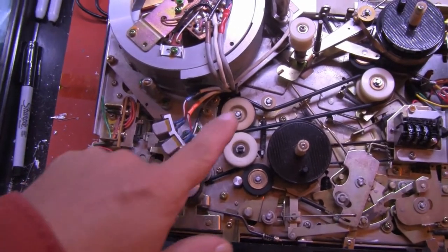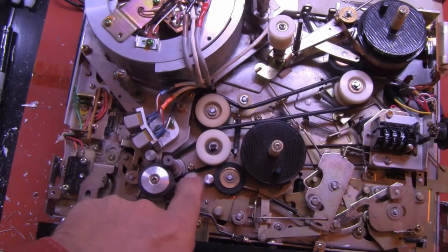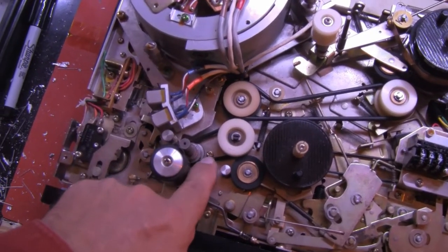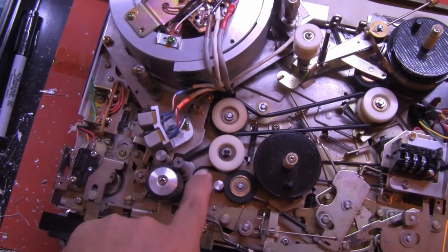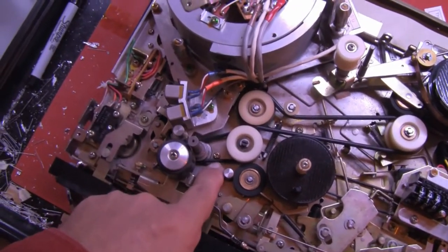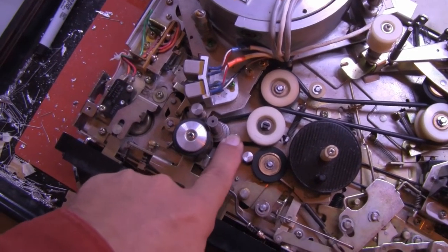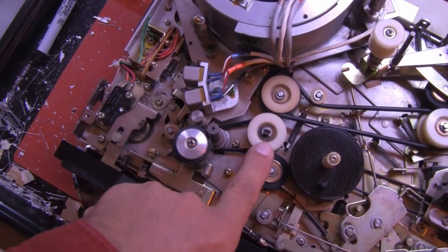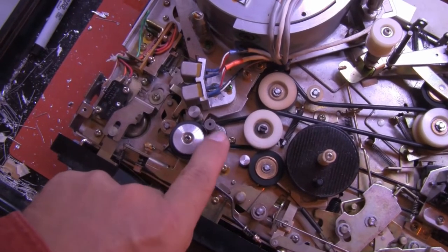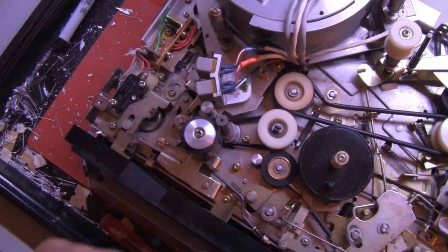So I will be replacing the small square belt. I don't remember its length — it's in the 4-inch range, not very long. I will be replacing that with a tighter belt. I was conservative on the length because I didn't want to put a belt in here that is too tight and either wreck the bushing in this wheel or wreck the bearings, which is probably another bushing in the capstan support.